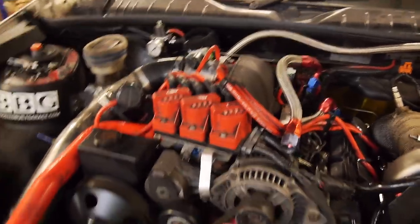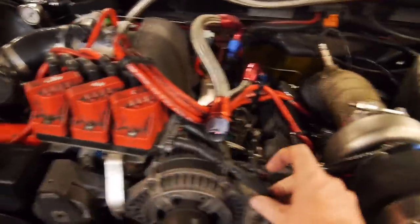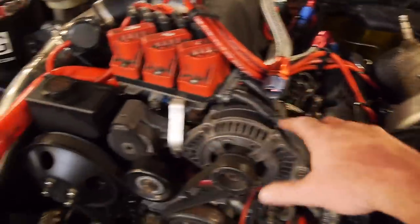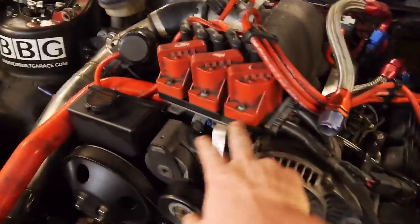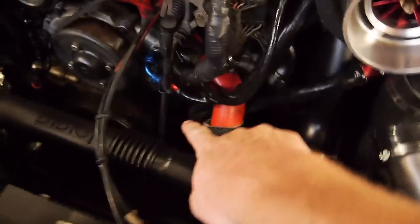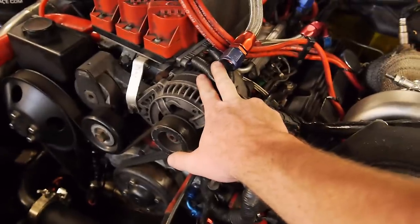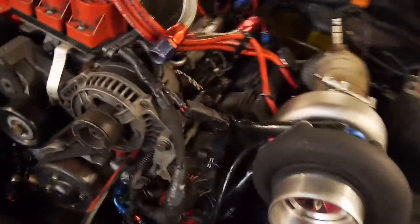Nothing has burnt - I've already changed this. These are MSD factory replacement coils; the DFI is under it. I've had to move all this stuff because it used to route across there and got burnt. There's something messed up in this wiring that I just haven't had a chance to sort. What I'm going to do is remove these coils, mount the DFI inside the air box, take a donor loom, run a whole new DFI plug, and run new shielded cable to the crank angle sensor - two signal wires, a power and a ground, all going to the DFI connector.